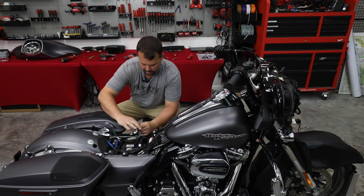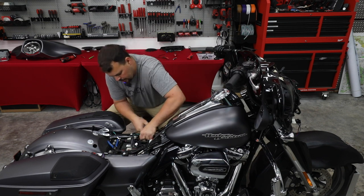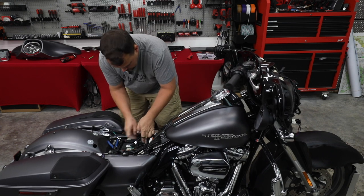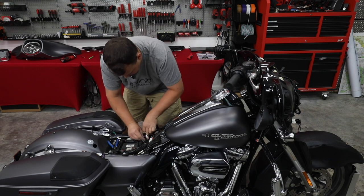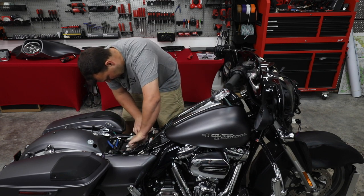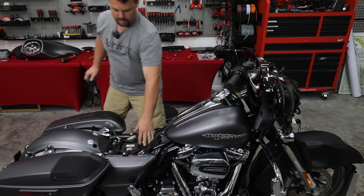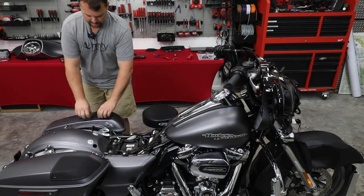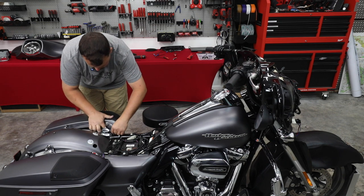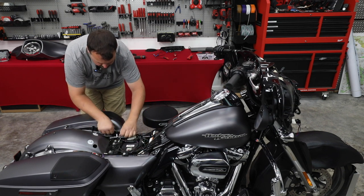We do this so it's not in the way later if you go to do any battery work. It's not gonna be something that you're having to try to fish or fight or get off on the top. We wanna get it where it's good and clean under the seat. Nothing's being squished from you sitting on it. And I'm just gonna continue by feeding the end of that harness in here with it. As you see, I was able to get it all the way down in there. I think that's a good spot for it. And we're ready to get to putting our seat back on. I'm gonna take this harness and feed it just a little bit more toward this way. You can always adjust it just a little bit afterwards, so it'll slide in those holders.